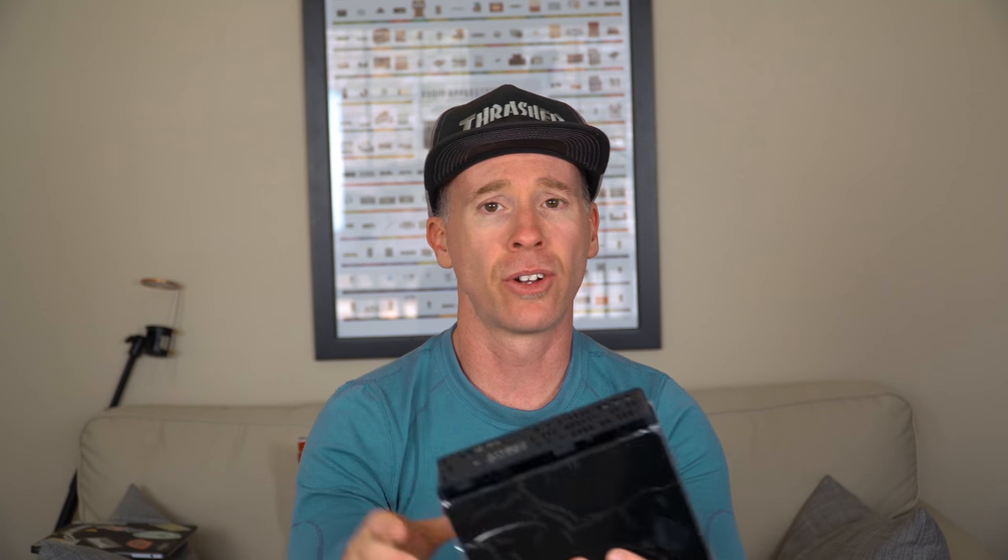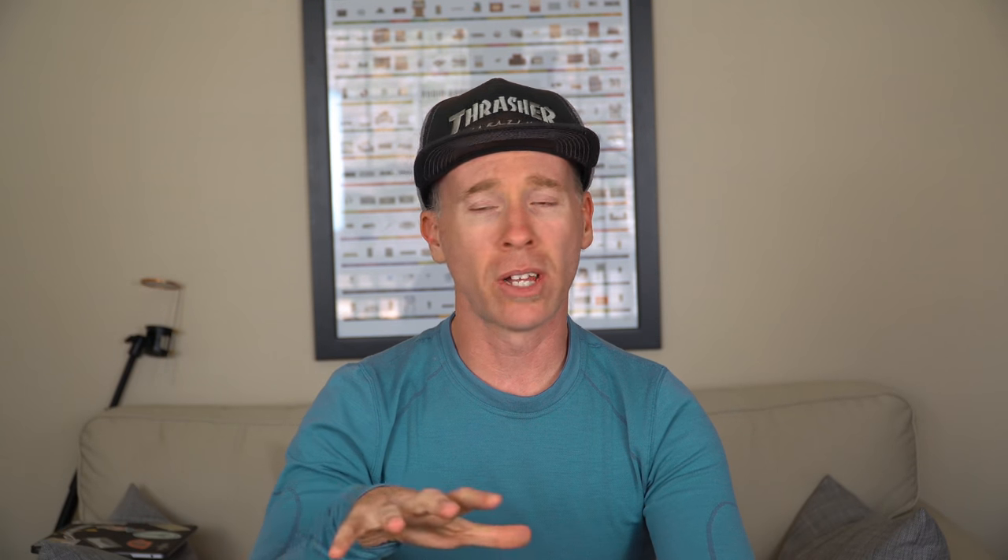Before we actually get into shucking this drive, I do recommend doing a test through your computer or whatever device you need to, to test this drive and make sure there aren't any bad sectors and that it's actually running well. You don't have to install any software — there is software in the hard drive because it's an external drive in itself. So don't go in and click to install anything, just run an integrity test on that drive before you put it in your network attached storage.